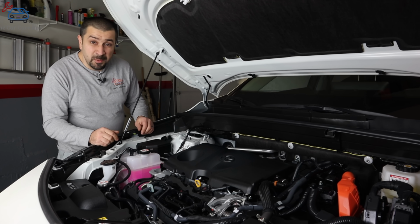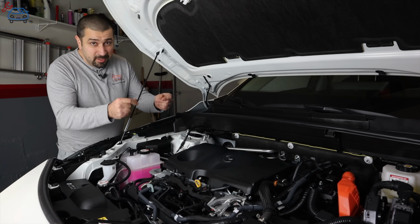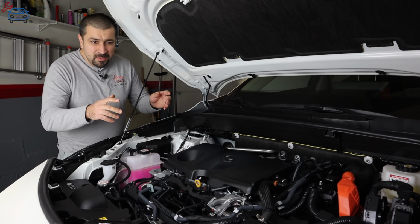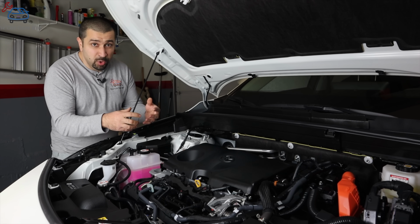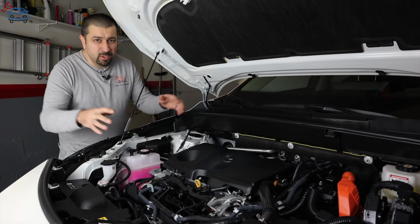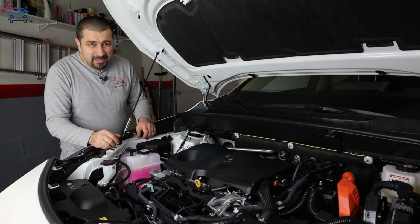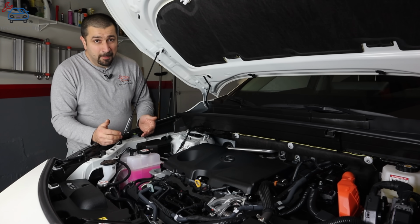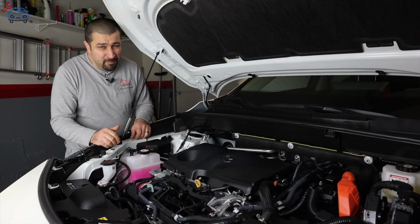So it's going to immediately spin it at 800 to 1200 RPM. From 0 to that, it has instant torque and it spins it that fast. That sudden spinning from the engine, going from not moving to all of a sudden 800, 1200 RPM, tends to have an effect of pulling oil through the PCV system into the intake. Now, normally that does not happen, but when you overfill these engines, there's a tendency of that happening.